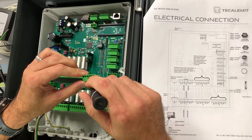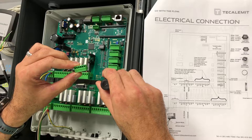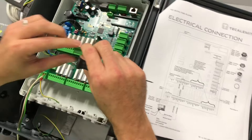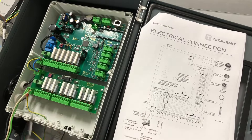Your power wire — that's your yellow wire — goes in the very last slot on the left, which is slot number six. Count one, two, three, four, five, six from the right — that's your power wire going in. Once you have all this hooked up, push the module back into place.